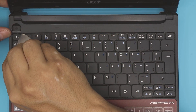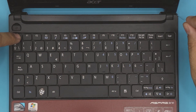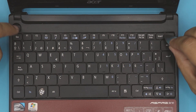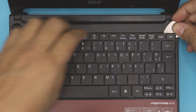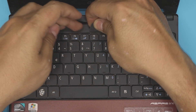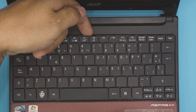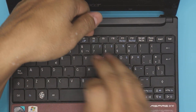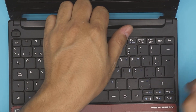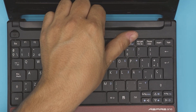This last one is not a push-in — it's a hard plastic, so you won't be able to push that in. Don't worry about that one. Go ahead and push the other corner. Once you've got the corner in, use it between F8 and F7. Put your finger right there and pull up a little bit to give a kind of curvature to the keyboard. Once you have this curve, pull this side out — there's a tiny clip there that you cannot push either.